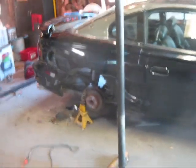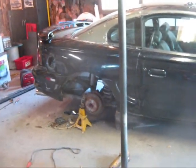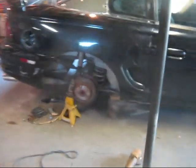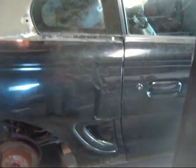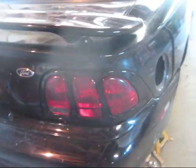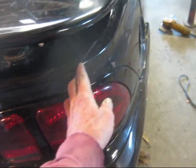I've been working on the old Mustang here again. As you can see, that quarter panel has now turned from a mock-up red to the black one that I am using. Now, mind you, this is just sitting on here. I have done some work, but we got a pretty decent body line going right there. Pretty decent gap. Everything's looking good — the bumper cover, the tail light, and all that's going on. The trunk lid we got to adjust just a hair more; it's just barely touching right there, so we got to give that a little bit more of a tweak.